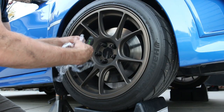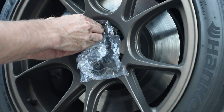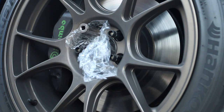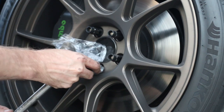We are gonna put on the hub centric rings. I know you guys noticed that when I put on the new wheels I did not have hub centric rings — I've got those now. I also have a little trick that one of you guys brought up. I'm just gonna wrap it around the lug nut, take my 17mm socket, shove it on there, and use my breaker bar to break all the lugs loose, then jack up the car. Hopefully this helps out a bit — it seems to work well.